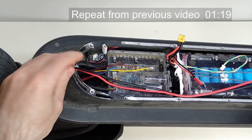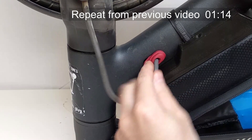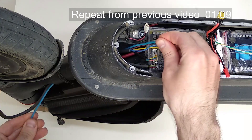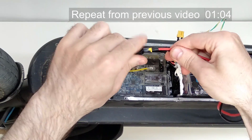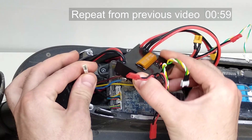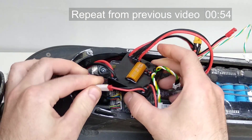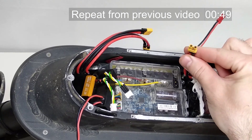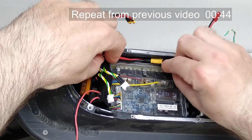Let's start the installation by laying the extra battery cable out. Remove the rubber plug, then take a piece of hard cable and lay the extra battery cable out. Before pulling the wire out completely, plug the charging port connector. And now finally put the device into the space in front of the controller. Let's start to connect the rest of the wires — the first one to connect is the power output of the internal battery.